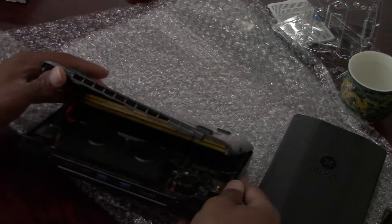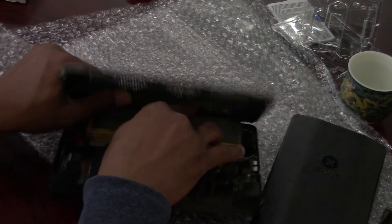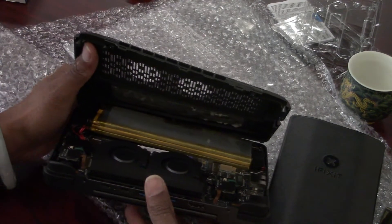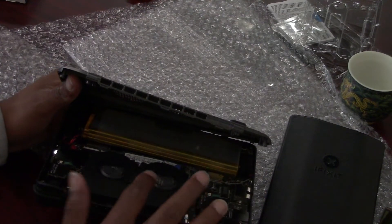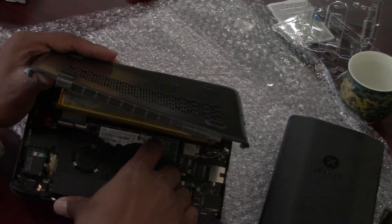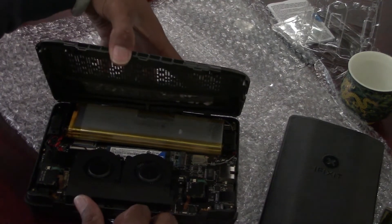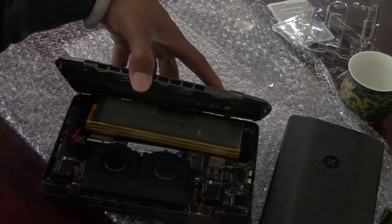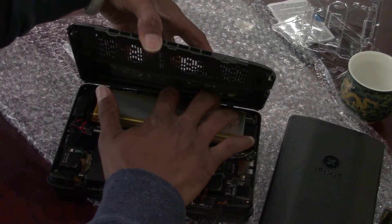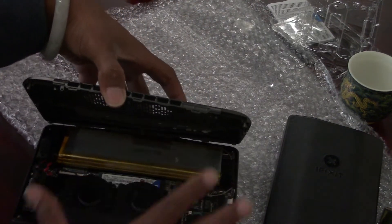There is a lot of glue and a lot of tape going on here. I had to hold my device like this literally as I performed surgery to get in the SSD. I did have to unscrew one of the fans and really take my time pulling out the 512 to put in the two terabyte. I did all of this while holding it like this — because this is the Indiegogo device, and there is a hinge right here that's glued, which prevents me from actually pulling the top off the back of the device.